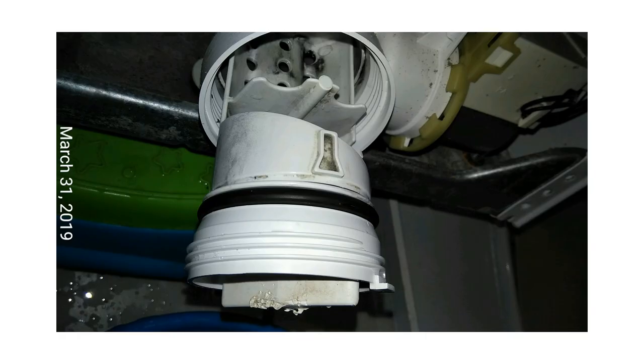So now we can put it back. For this machine, it's really easy — you can only put the screen back in one direction, because of the tab here and another one on the bottom. The two tabs are different, so you cannot put them in any other direction. Your washing machine may not have these nice designs; if that is the case, you need to make a record at the beginning of which direction it should go.